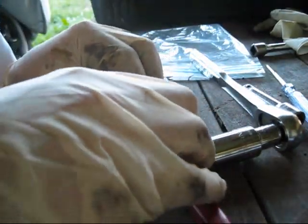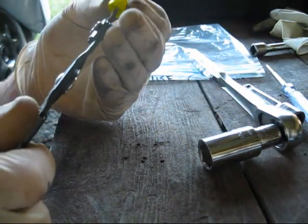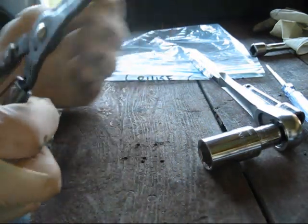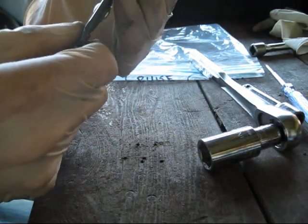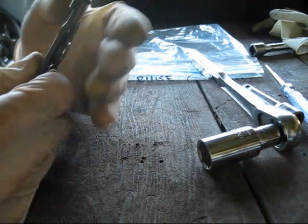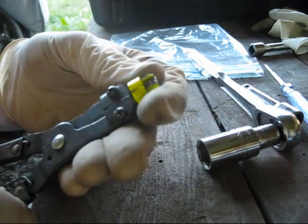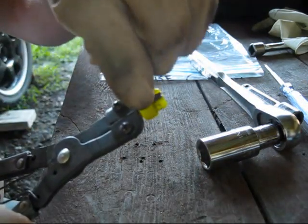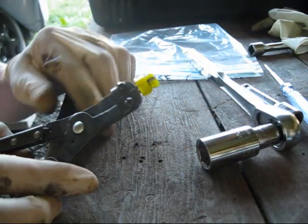And here's a little trick for getting this guy back on that wire, because it can be a pain laying under the car or under the dash and trying to do it. If you have snap ring pliers, get them lengthened out real far so it slides right up there, because it's going to want to shoot out of this thing because it's tapered. But you basically press it in there, and then you just gently open it up. That'll let you at least get the wires set inside there and then pull them out. So that'll just make it a little bit easier on you guys.